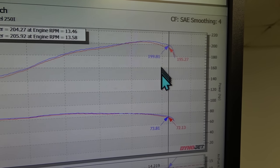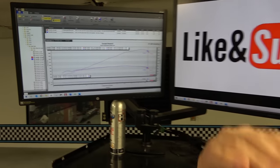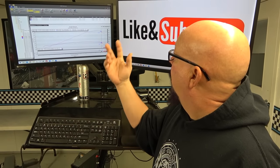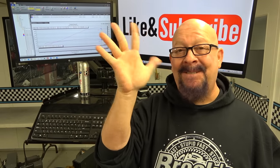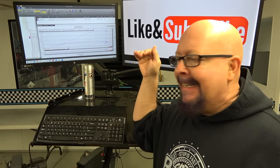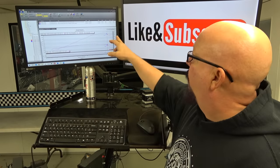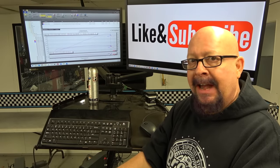195 to 199.8. So up in the very higher revs, that sprint filter was worth 5 horsepower, 193 to 198. Now think about this also. The bike is on a dyno, it's a static application. It doesn't have a 150 mile an hour breeze going through it. So the sprint filter is worth 5 horsepower up top with the bike stationary.